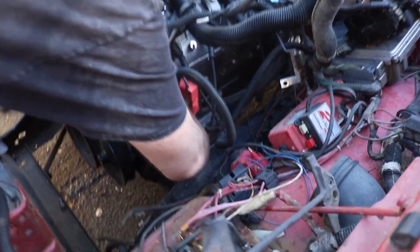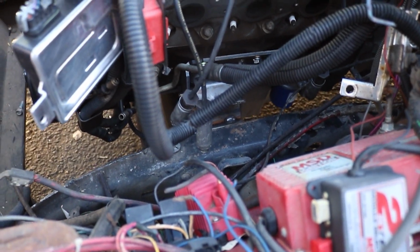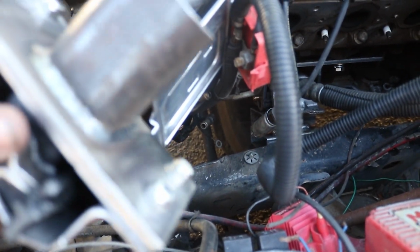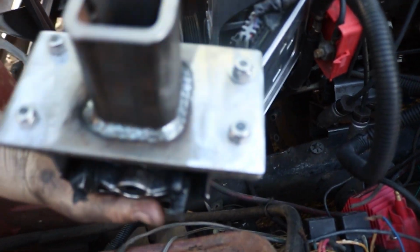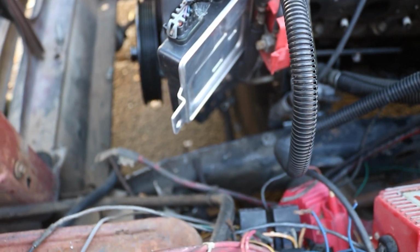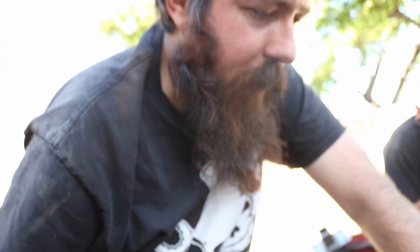We're gonna lift this up. We're gonna pull these engine mounts out via these bolts here, taking this nut off just enough to pull those out. We're gonna take out them blocks and slam in these bad boys that we just fabricated, get the engine leveled out, and then tack the bottom sides onto the chassis, and that'll be the engine transmission mount. Mock-up stuff will be done, and then we can yank the motor and trans back out, unfortunately, and finalize everything, which is the fun part.